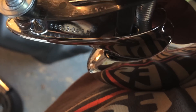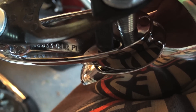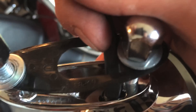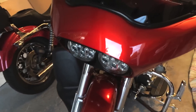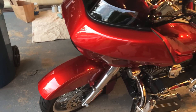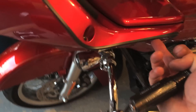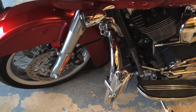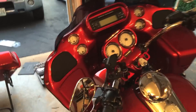I learned something putting these blinkers on — there's a left and a right. If you look at the number inside, at the very end it says RP1 — that's the right. The other one has an L. They do slightly make them angle differently if you switch them around. So there it is — it is back together. Fairing is on. Reverse the procedure from taking it off. Followed the same procedure from the other video for the headlight replacement: hung it on the hooks, made sure the wires were out of the way, made sure the outer fairing tangs were on the inside of the inner fairing tangs — you'll see that in the other video. Got my six screws in there and my blinkers on the correct side. New looking bike — totally different look, that's for sure. Gonna take me some getting used to.